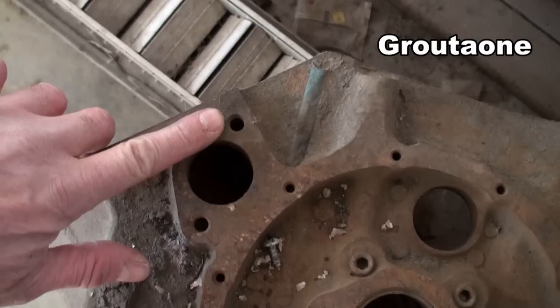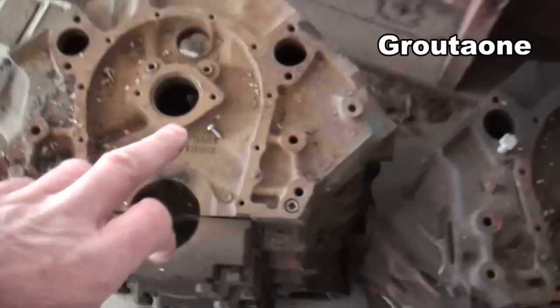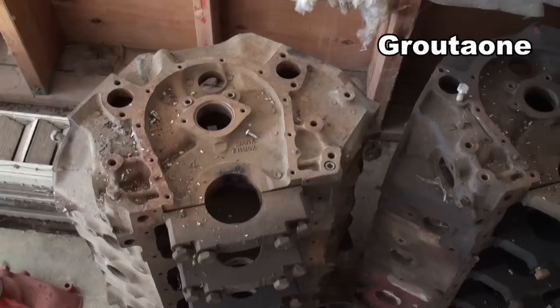Here's the big difference on these. Look at the distance from the water pump bolt to the top of the deck — I can kind of about put my finger in there. And then if you look at the 454, there's a lot less distance there. They called these the tall decks. What they did back then is they put an extra compression ring on the piston, so they had a tall piston to deal with, and then they just made a tall block to accommodate the long piston.